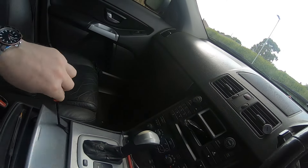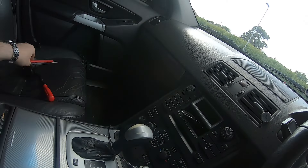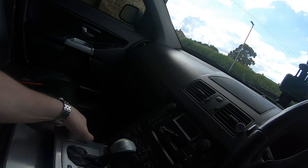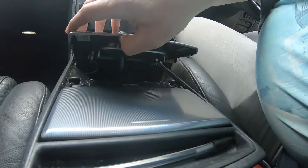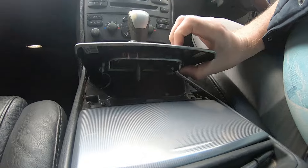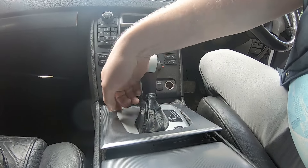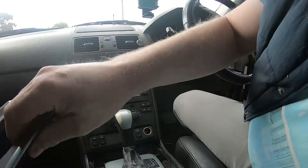Using the trim tool, it just pops up. Move these items out of the way and then I need to lift this out and separate this as well. It's a bit hard to do one-handed. There are tabs that need releasing - just push the tabs in. There's a couple at the back as well. That should free up the rest. There we go, and then this can come out. I don't even have to move the transmission lever.